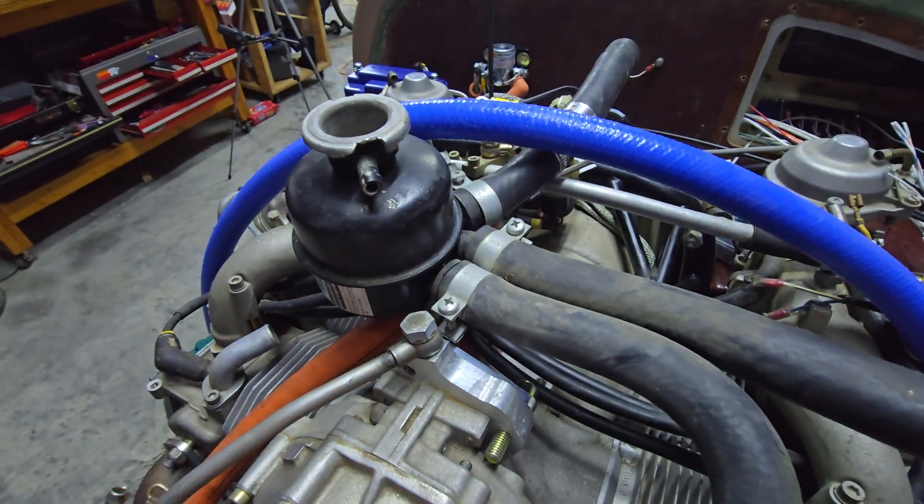Also, upgrading these clamps to the Rotax-recommended spring clamps: I went to Rotax's website and they charge a ridiculous amount — just to replace all of them was well over $100. Doing more research, there was a forum post that said these are the equivalent, with the website and model number. I bought 21 of them just to have an extra set on hand, and there was a discount if you spent over $25, so I got all of these for way less than what Rotax offers — same diameter and everything.